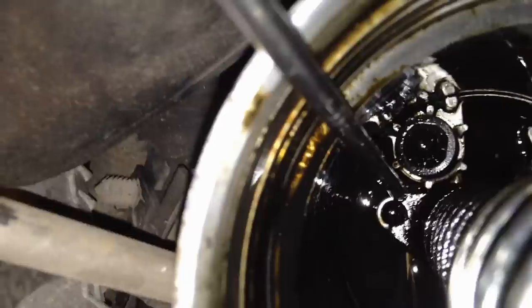This is why the dealership sticks with Motorcraft — that filter is designed specifically for this engine and provides the right capacity. There's no reason to go with anything else. Hopefully this provides some insight into aftermarket filters, whether it's fuel, oil, or air — they usually don't fit right or filter the same as OEM. Bigger is not always better. This job has already cost them $700 plus, and we're still going into the oil cooler with more labor and parts, all because they went aftermarket.